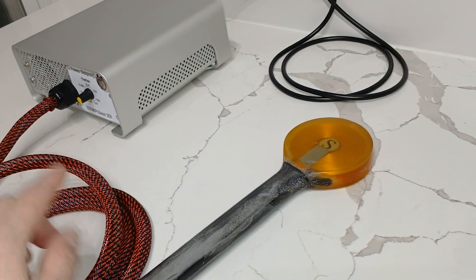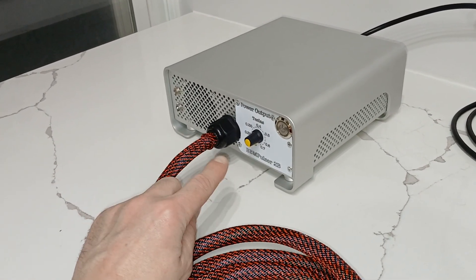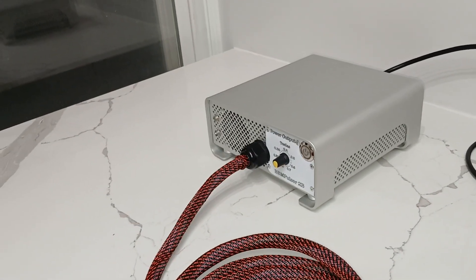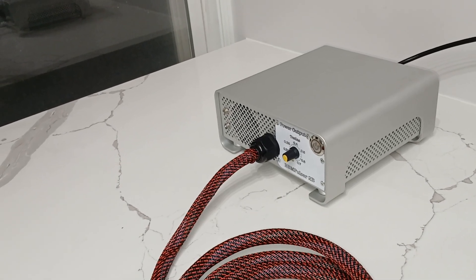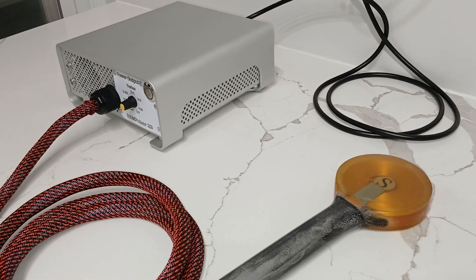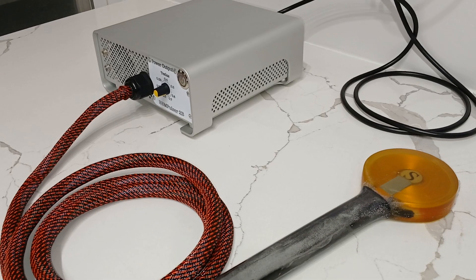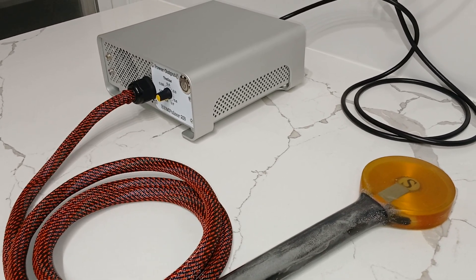When the coil surface gets to about 75°C — or 60°C at the thermal switch — the thermal protection will trigger: a built-in sound alarm will start beeping and the red protection light will start blinking. On average it consumes 325 watts, and on maximum 375 watts. It has a built-in silent fan and silent operation.